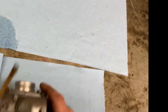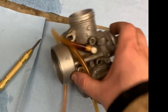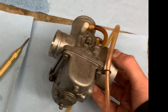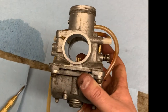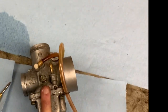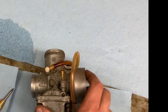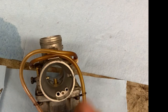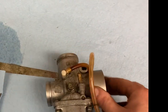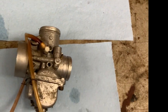I went ahead and put the screws back on and the overflow hoses back on. That's it — quick and dirty clean. Let's put this back on the sled. This isn't a professional-quality clean — it's just to clean out the bowl, make sure there's nothing causing it to pull too much gas. My main suspicion was the needle float valve getting stuck. We'll throw this on the sled and I'll update you guys on whether she runs. If you want your carb spotless, take a couple hours and clean it properly with a brush. For me, as long as it's functional and she's going to run, that's all I care about. Thanks for watching!